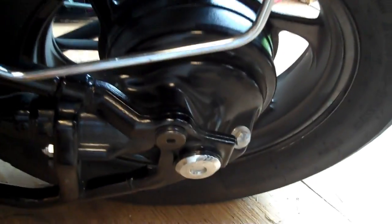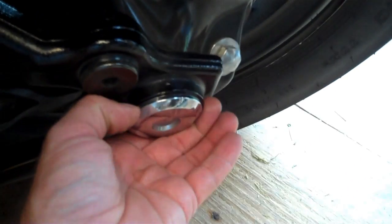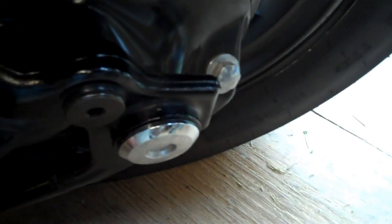Excuse me, they're tied down here. We got to untie them first, but you got the point. Okay, now that we got the bags out of the way, your first step of getting this axle out, right here, this cap, you might get lucky to pull with your finger, but not likely. But there's a little tab, a little hole slot right there. It may be positioned anywhere, but this one's right there. Get you a flathead screwdriver, get it behind it, wedge it out.